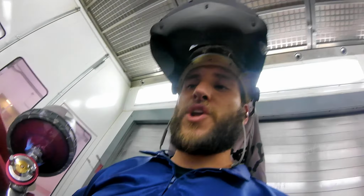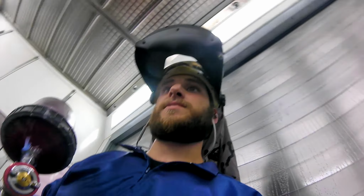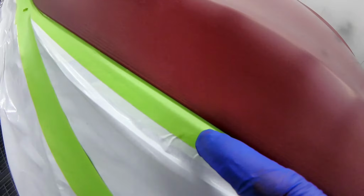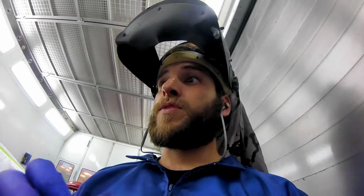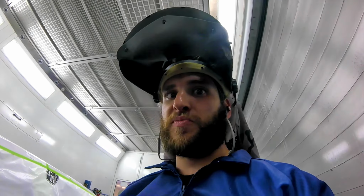With these Teslas, they have a lot of pearl on them. And to prove to you that they have a lot of pearl on them, I actually noticed something: if you go and look at a red Tesla, you realize this. The edges of the Teslas, I don't know if you can tell, but I can tell, they're actually a little bit darker than the car. That's because there's such a buildup of pearl on there. So when you think you've got coverage with the pearls for the Teslas, you've got to apply a little bit more. Trust me. Here we go.